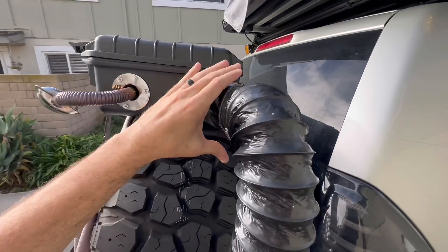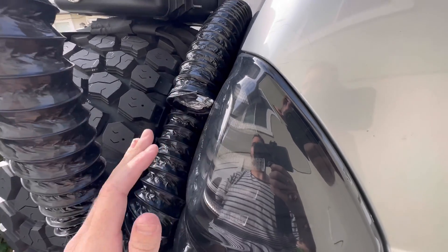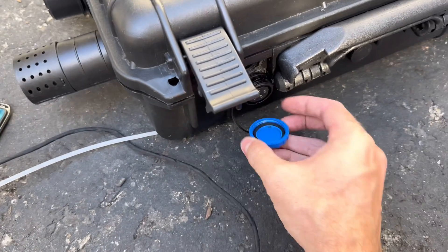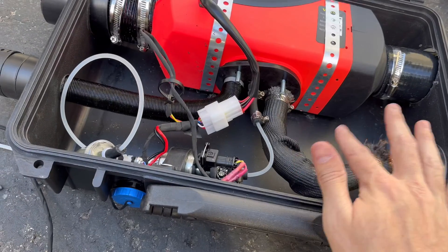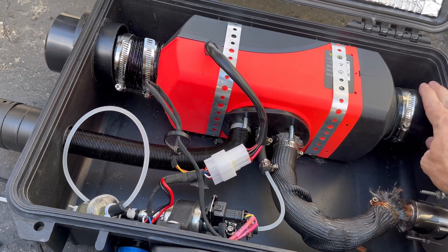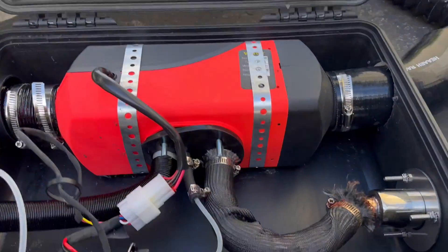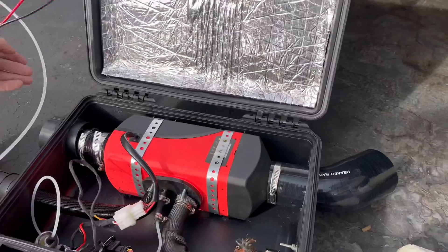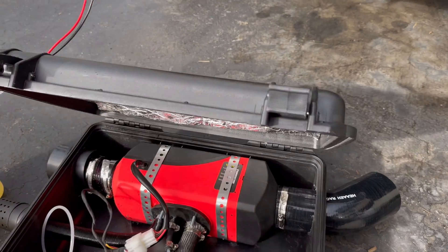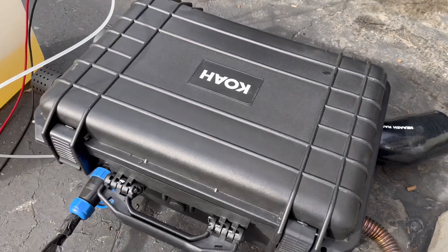I only ran the heater for about 10 minutes and the air is already piping hot. All the pipes are up to temperature, as you can see here, and I can't hold my hand in front of the outlet for more than a few seconds. After that, I powered the diesel heater down, unplugged it, and put the cap back on. Now I'm just doing a temperature check — the insulation is working great, no more hot spots on the outside of the plastic. Subscribe to see more of the diesel heater build, check out the links in the description from Vever and BC Off-Road Shop, and we'll see you in the next video.